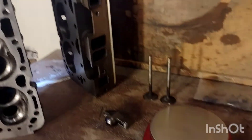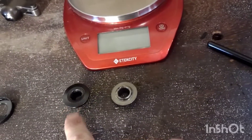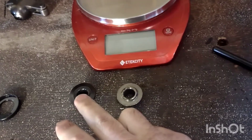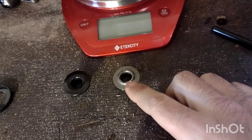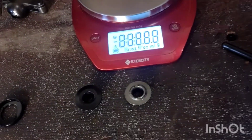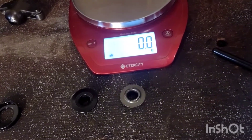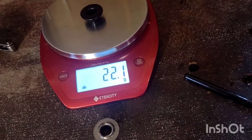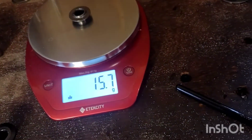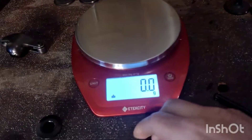Now let's take a look at some of the parts that go onto the cylinder heads. Right here we have a couple of valve spring retainers. This black one is just a basic stock replacement — really cheap, from Speedway. This one here is a GM Performance tool steel valve spring retainer. The idea behind the tool steel is that it's stronger, but we're not allowed to run titanium. With it being a stronger material, you can use less of it — about 22 grams for the standard steel retainer versus about 15.5 grams for the tool steel retainer. That's less reciprocating weight and allows for better valve control.